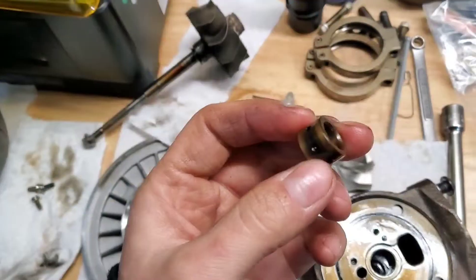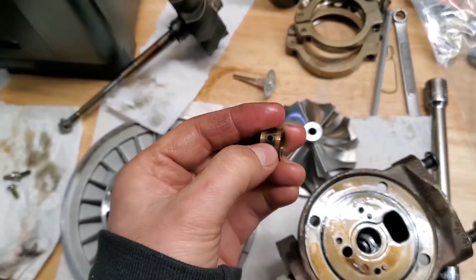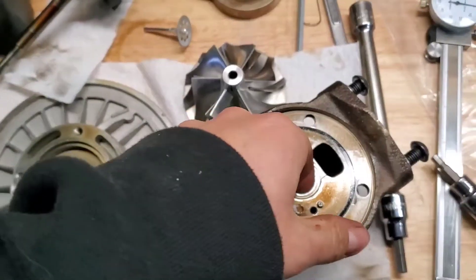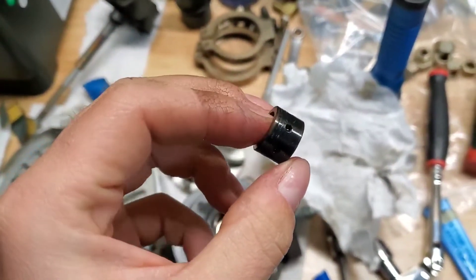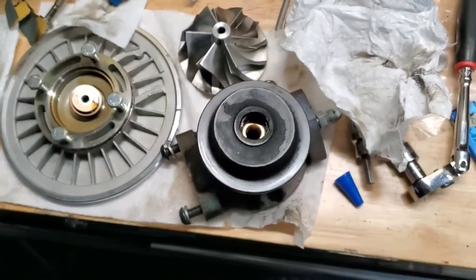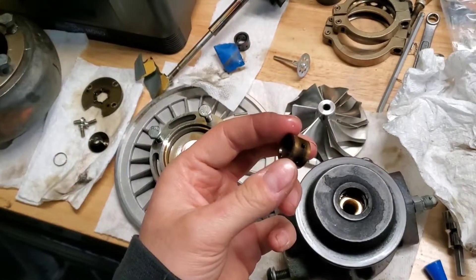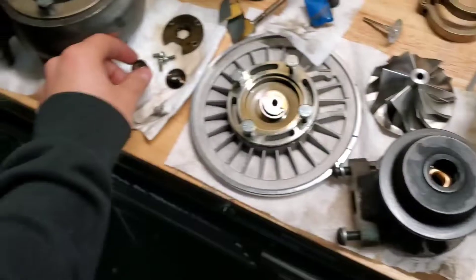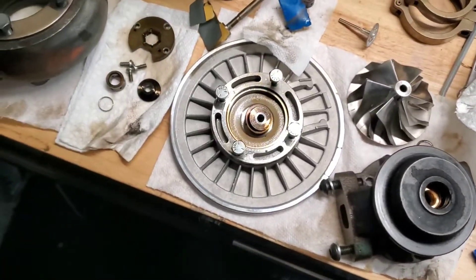The rear oil seal looks pretty beat up — you can tell it's been overheated, there's a burn mark on it. But the inside still seems perfectly fine, which is great. I took out the old piston ring and popped the new bearing in. Here's the old bearing — you can see two grooves worn into it. This turbo might only last about a week considering it'll be running 100,000 RPM. Here's the rear bearing and the front bearing, which isn't too bad. When checking shaft play you can feel the front and thrust bearing, but you can't really check the back — so I'd bet that was the start of all the issues.